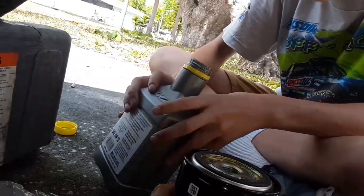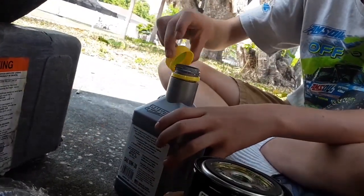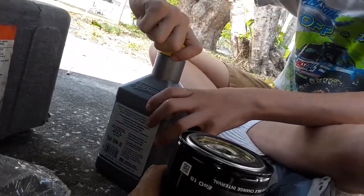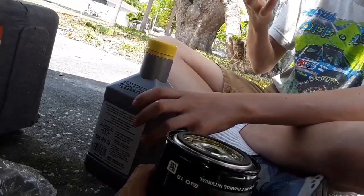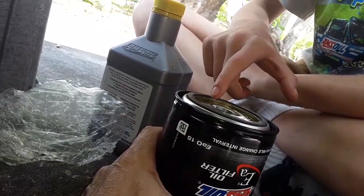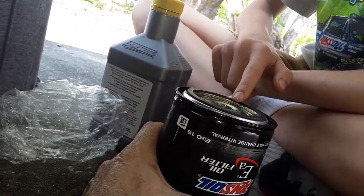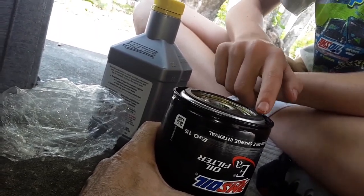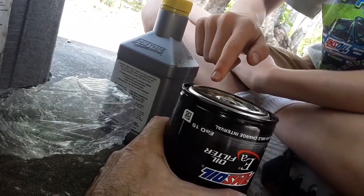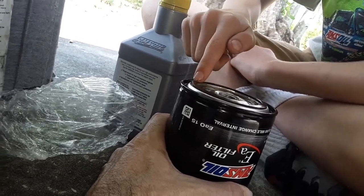All right, that should be good, because we got it at a slight angle. Can you cap it? Put the cap back on. We want to keep that clean. And then, is your finger clean, basically? All right, go ahead and just do the, don't get any foreign material in that center hole, because that goes right to the bearings. And this oil is filtered to 2 microns absolute before bottling, so that's the reason I can pre-fill with confidence.